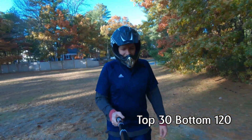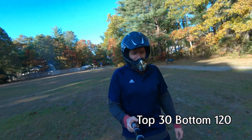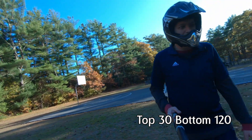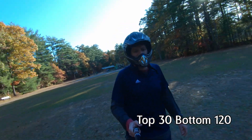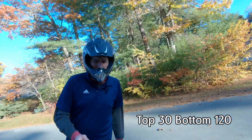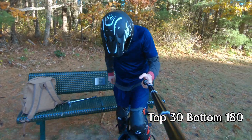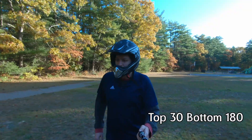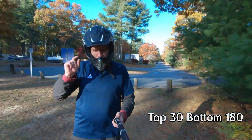This setting I like the least. It's still not getting rid of enough chatter coming across the field, and I feel like I'm bouncing too much. The drop's okay but whatever — I liked it better higher or lower. Now I'm going to try 180 pounds of pressure on the bottom — way jacked up. I definitely feel too tall and not getting much sag, but high pressure is definitely better than middle pressure across the field — surprisingly.